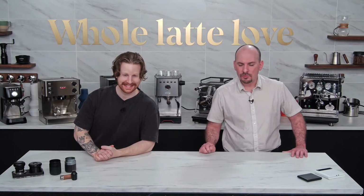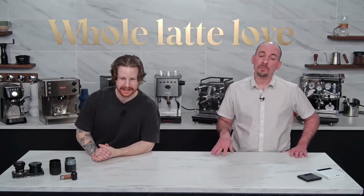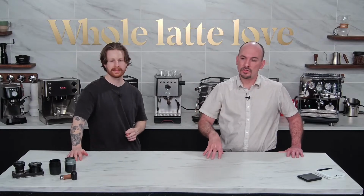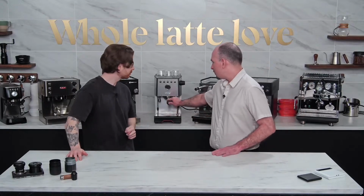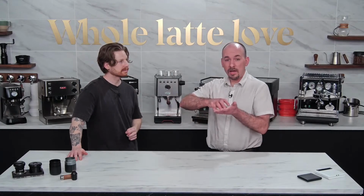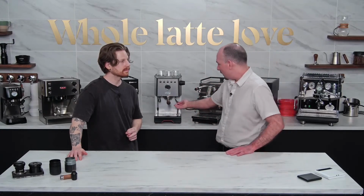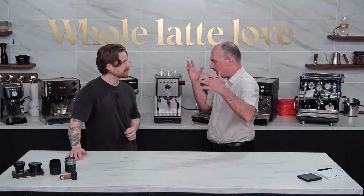Yeah, I'd have to know which machines in particular you're talking about, because that's what you're addressing. SCP is specifically why I don't like to stop the pump on certain machines, because it does then open the valve to go down to the drip tray. But typically, and you'll see even on the classic GT here, the group remains pressurized. It's kind of like that soda can pop when you first take it off. If you take it off in the middle of that, because the pressure has still built up before it started extracting, you're not penetrating through yet, so if you relieve it, there's a little bit of pressure that just, some people call it a sneeze.